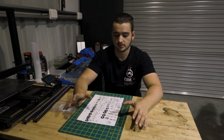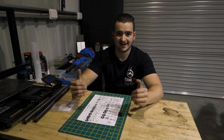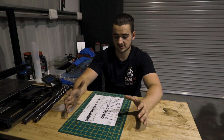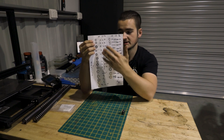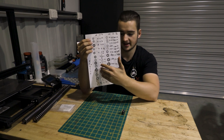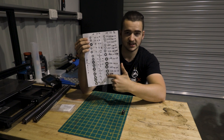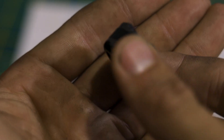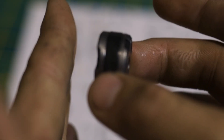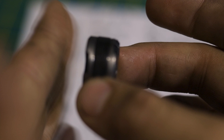Forks are fully disassembled. We're now going to talk about revalving the forks. Here we've got our shim stacks — this side is compression, this side is rebound. It starts from your biggest shim down to your smaller shim. On one side we have our compression plates stacked like this, and on the other side we've got our rebound plates stacked like this.